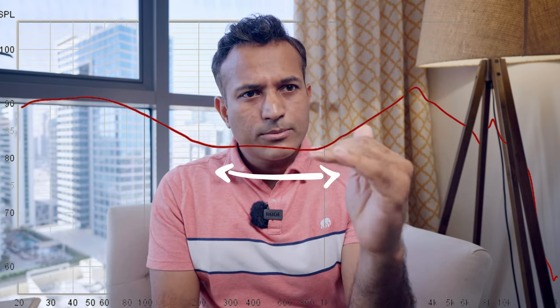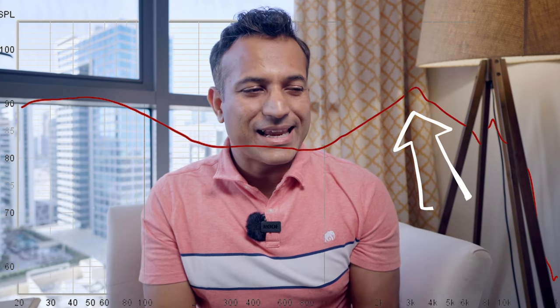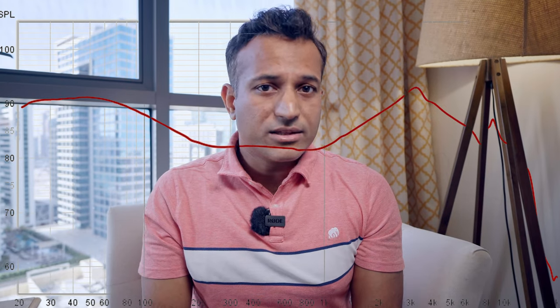Then you've got a mid-range with a little bit of warmth, but not so much that it affects all genres of music. And then there's that really weird peak at three kilohertz — usually you don't see something that rises up that linearly, but the fact that it does is a good thing; it means it sounds nice and smooth. A three kilohertz peak is sort of the appropriate place, depending on who you ask. And then you've got this steep fall-off, and while that peak is quite high, it's the fall-off that prevents this IEM from ever getting harsh, sibilant, or offensive. You've got a little bit of energy in the treble as well, and I didn't hear much of that metallic timbre that people talk about with balanced armature drivers, probably as a result of this tuning.